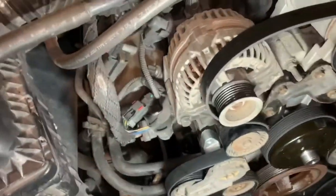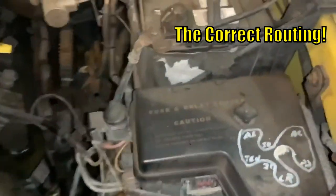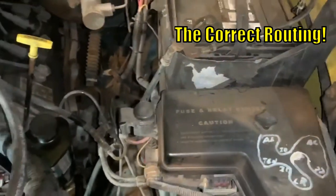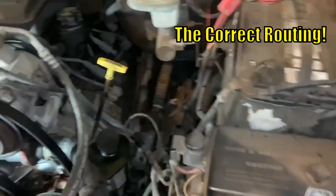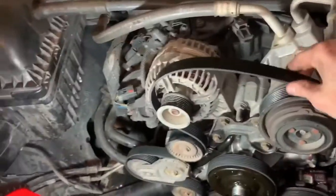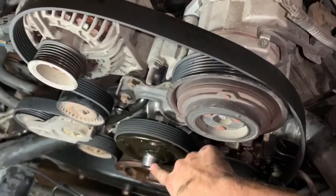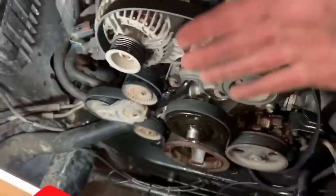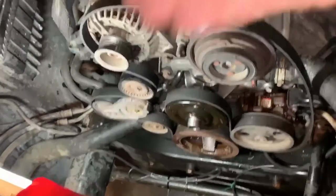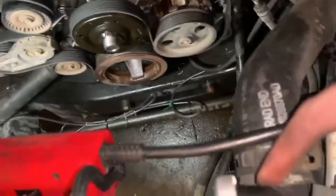All right. Anyway, so we got our chair right here, so I'm going to use both hands to get it right. But once we get that on, then we'll be able to put the fan back on first, because of course you can see this isn't right. We'll get this right. And then we have to put the fan back on first because it sits inside the shroud. Then we'll be able to set the shroud in, bolt that down in the two spots up here and over there,